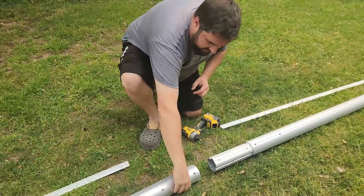I'm on top laying on the roof, and a big part of making this go smoothly was I pinched the fabric and kind of pulled it up so that it wasn't pulling against the bottom of that guide rail. And that really helped get that moving as we had the feeder at the other end as well. Once the awning is through the RV rail, then the next step is to attach the metal brackets from the legs to the top and the bottom.